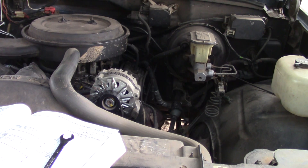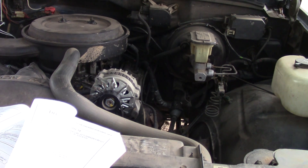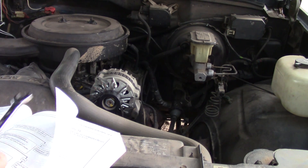It's a good idea to change these sensors out at least every time you change spark plugs, which is about every 30,000 to 36,000 miles on these trucks — just as regular maintenance. Hope this helps. If it does, please rate, comment, and subscribe if you haven't. Stay tuned for more.